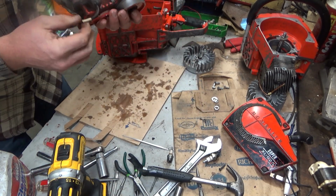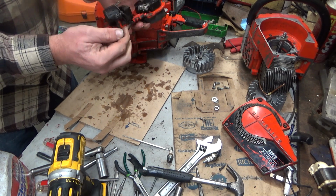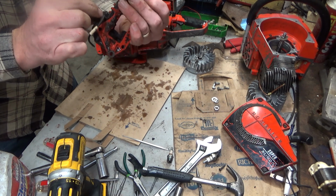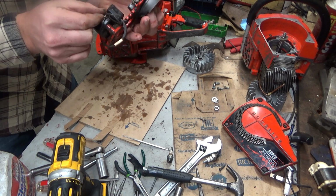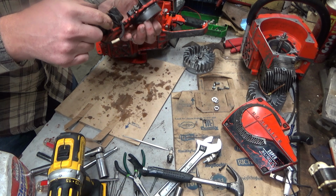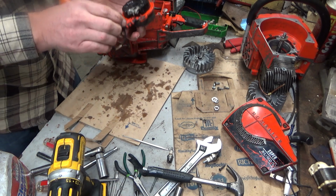Alright. So this may have already had a repair. We can put a new end on that. But you see how those two leads go in right there? Now they look okay. This is the replaceable lead. This goes to the transformer. So what I've got to do is fish these out, get the new one in there, and put a new wad of silicone on it.